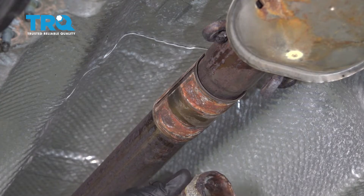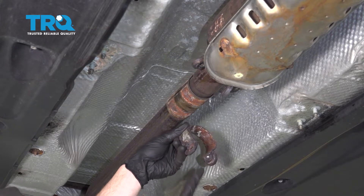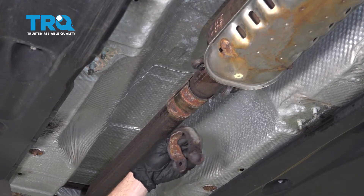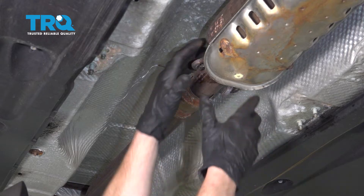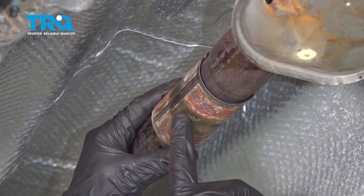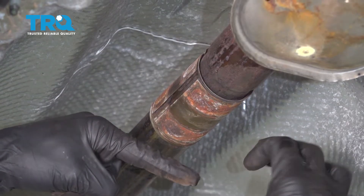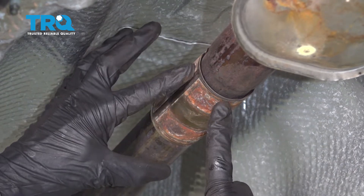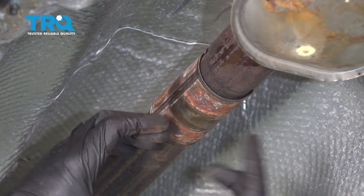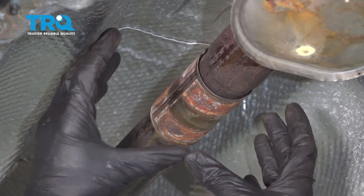Take those right off. Ours broke, so I'm going to replace it. If yours broke, you can knock out the bolt and replace it with a brand new nut as well. This clamp is multi-layered because the two pipes butt directly up against each other rather than overlapping. One piece goes around the two tubes and has a slot; another piece goes around that same piece. Make sure the slots are not lined up — they need to band-aid all the way around.